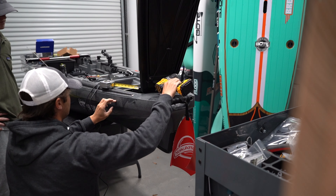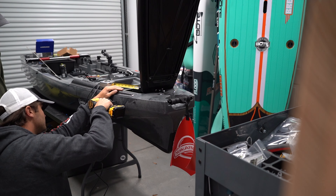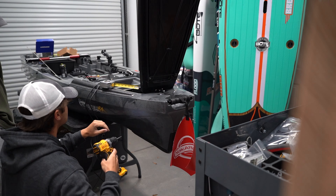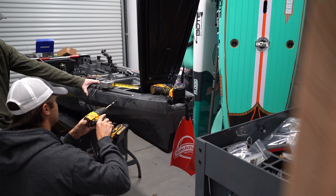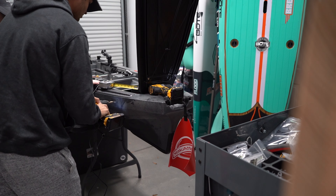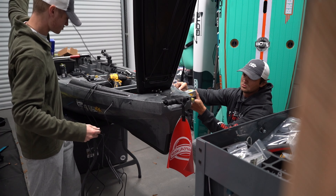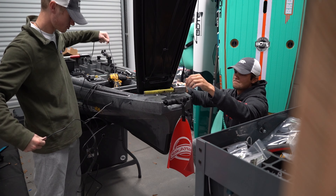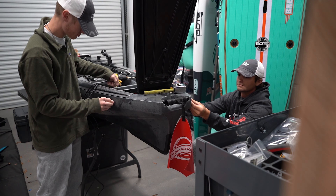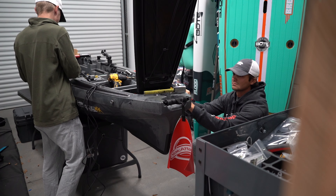The customer also wanted the Yak Power 10-inch nav LED strip lights, so we're throwing those on the front. He's eventually going to do a motor setup — he's still undecided whether he wants a bow mount or something like a Newport on the rear of the boat. So we went ahead and threw those on so we could tie them into our Yak Power system right away. Once he decides on which motor setup he wants, we can install that, and he'll already have those nav lights installed so he can be legal on the water.